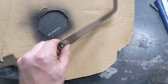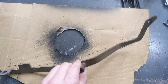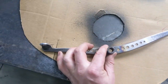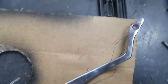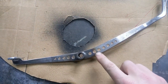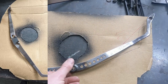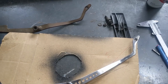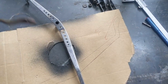I put that on there and that's where it worked out. I used that as the starting point, then cut and welded a standard six-cylinder pedal to extend it. If you line up the lines — which I think is done reasonably well — you follow that to the edge and it's in the corner where I wanted it to be. I've cut the section out there and welded it in, added some holes, and that movement in that plane brings it further forward and further down towards the floor.